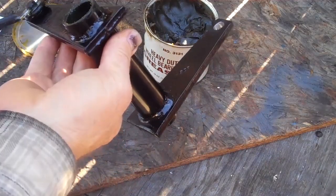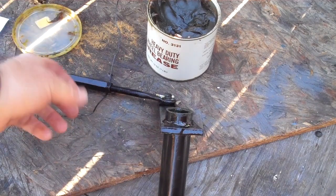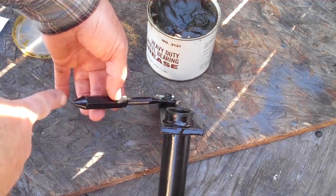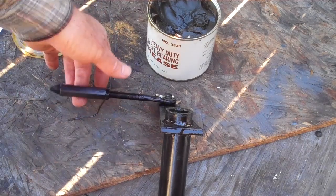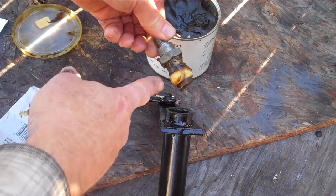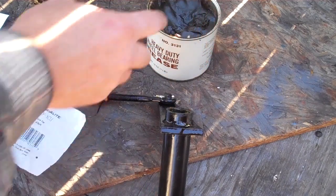There are all the parts together. I've got the equalizer rod in my hand here. That's where the equalizer bar — this rod connects the equalizer bar to the clutch release lever. The clutch release lever fits right into that little chamfered end. I've got this bushing all greased up because I had to replace it since it was worn flat, so that inserts right in there. This goes into the engine housing, so I'll put a little more grease on there.